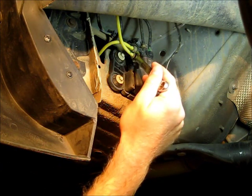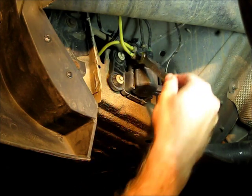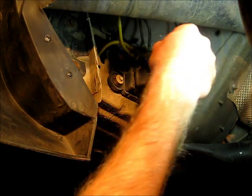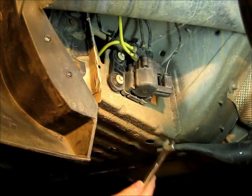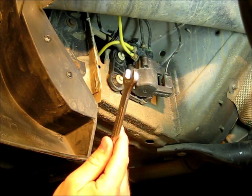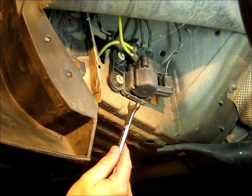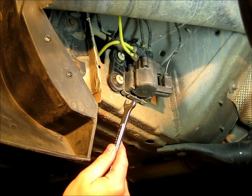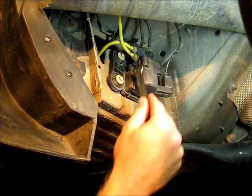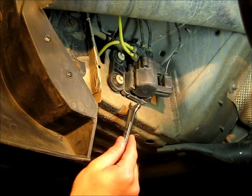Come back in 10 minutes, and when it's all depressurized, close it back up. Make sure these are nice and snug — don't over-tighten them, but make sure they're not going to leak. When you do this, make sure everything underneath the car is removed because it's going to depressurize and lower the car down towards the ground. I put jack stands underneath the frame members so the weight of the car is already resting on those jack stands. Then simply allow the vehicle to lower down and depressurize, tighten everything back up, and you're done.